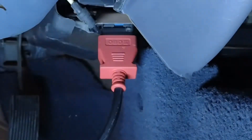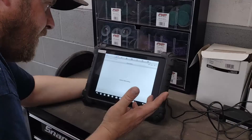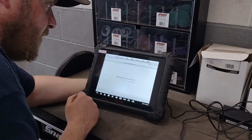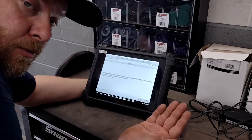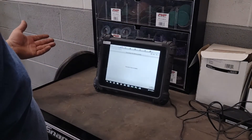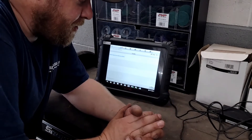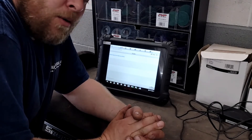I have a couple of scan tools at my disposal, so I'm going to get it hooked up and get this memory reset. A couple of clicks and you're pretty well done — throttle reset, Keep Alive Memory reset, just like we talked about. It's telling you that the PCM has stored adaptives for idle and fuel, and asking if you wish to continue. Test is now complete, which means that it has reset my idle and fuel. Hopefully my junkyard mass airflow sensor isn't a piece of crap — we'll find out.